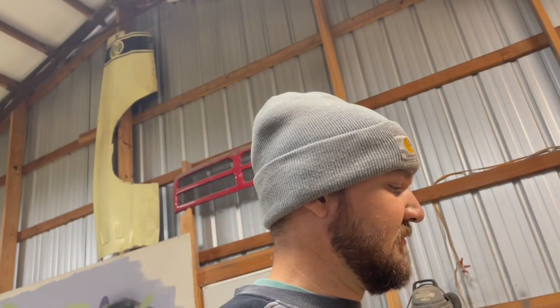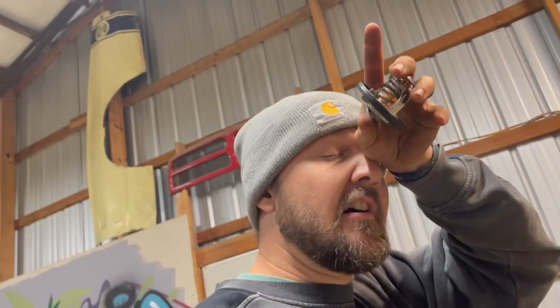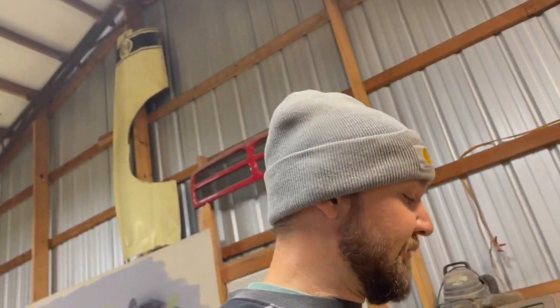The pre-Eagle heads, which this one is an '08, the last year, these heads, before they went to the Eagle heads, have a known problem of dropping valve seats. And most people believe it's because of heat. Some say MDS, but most people have come to the conclusion now that it's just heat. So I just figured anything we can do to help this thing run a little bit cooler. And I know all the theories out there of, well, you're really not doing anything. Yeah, I know. I just want to run a 190. So how about that?